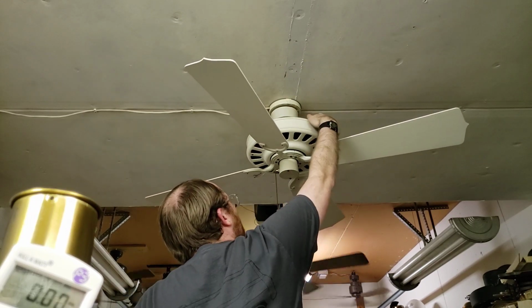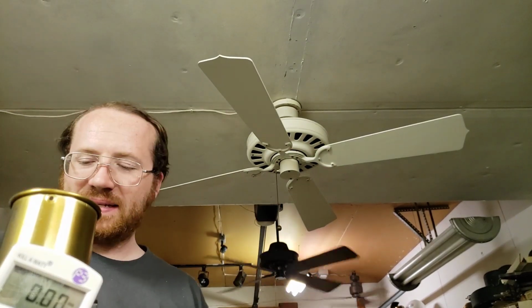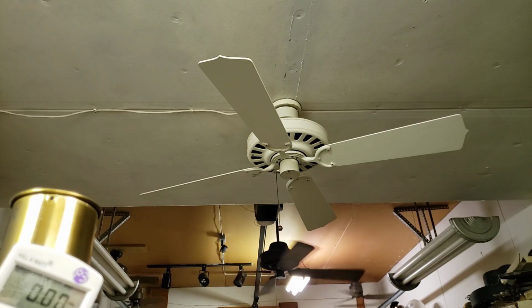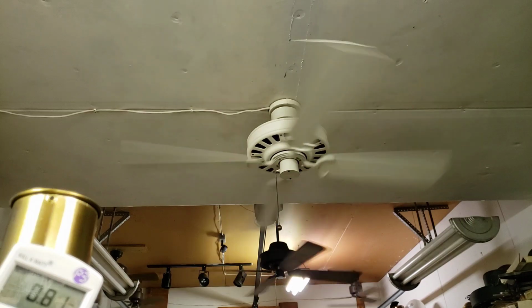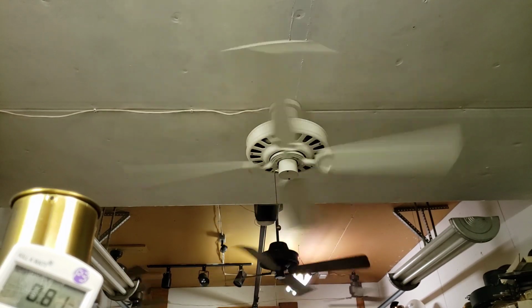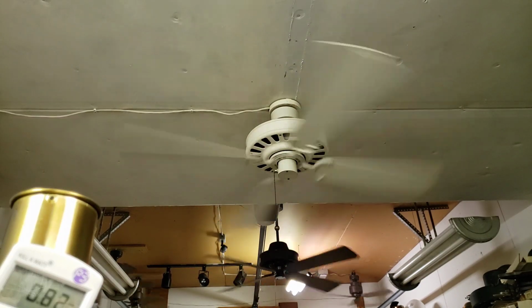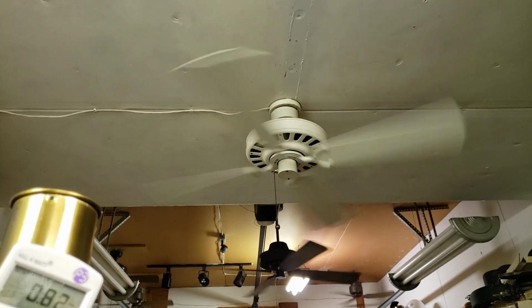Those stepped blade arms really do make a visible difference in the design of it. It's interesting looking. When I picture an 1895, this era of turn of the century, I always picture the later smooth ones, because I think those were the first ones I ever saw. Let's see if it's a different inrush. I don't think it will be, but one of the things I learned in the 1895 workbench video is that there are three different versions of irons for 1895 type fans. There's stepped, this is the first one. Then smooth. Then there are ones that are smaller, so there's a gap between the motor housing and the irons. I know exactly what you're talking about. The really light ones were like that. So it actually went up to 0.82, and there was no inrush.